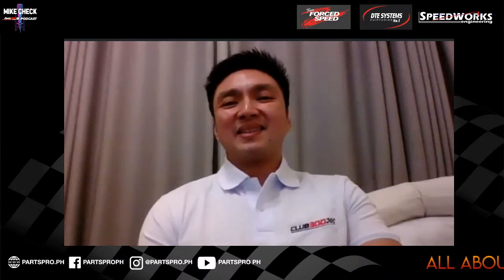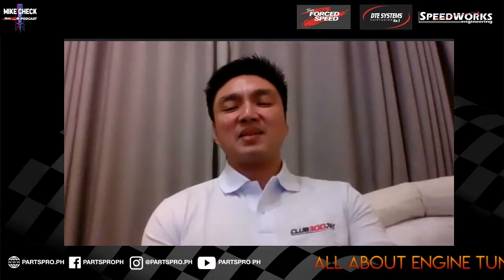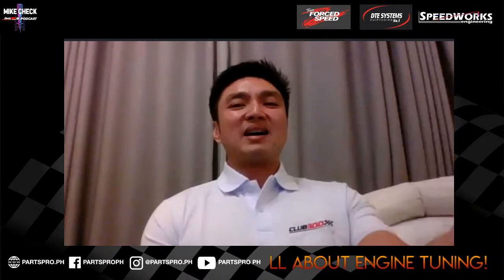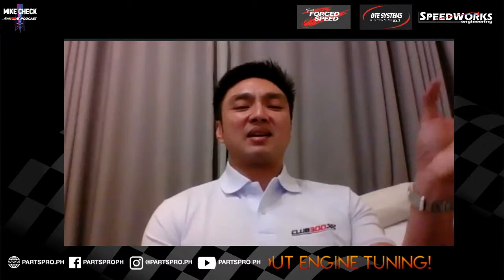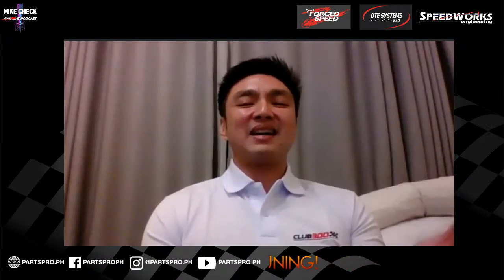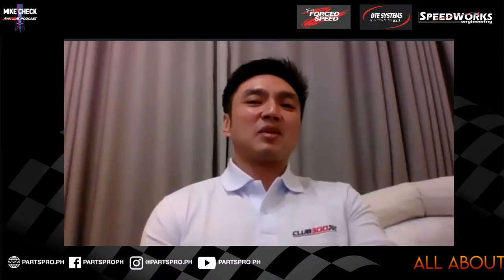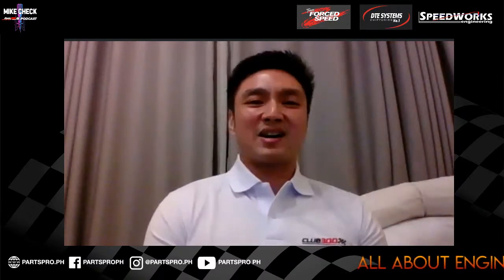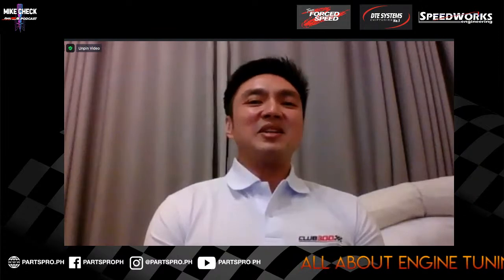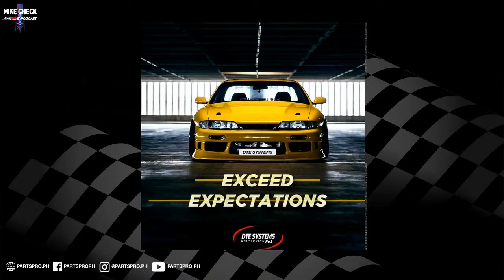That would depend on the time that the car was released. Before, it was really rich. During the Hondas that we used to tune, it was rich, and for a B16, say, it would have maybe about 10 ECU codes for the whole world. But now for, let's say, a Toyota Supra, you'd have more than about 50 for the whole world. So the newer cars run leaner because of the emissions. Even in city level, the Porsches, the Audis, the newer cars, they run leaner.